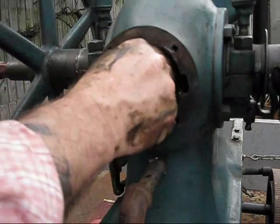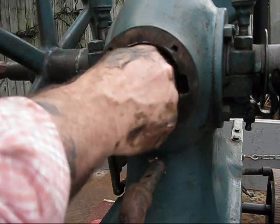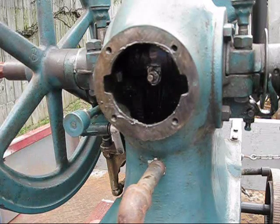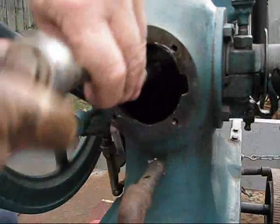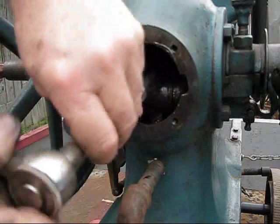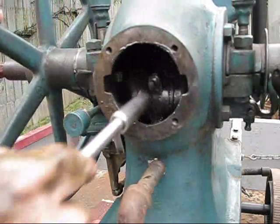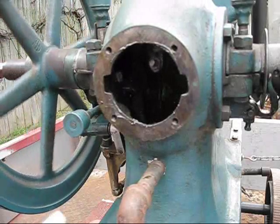There is a flat position on the bolt that was used. Just get in there and take the shim out. Sometimes you will drop a shim down in the bottom — get it out, don't leave it in there. I just took one shim out of the top and one out of the bottom. I don't want it to lock up on the flywheels when I tighten it up, and it didn't. So that's about six thousandths I took out of there.